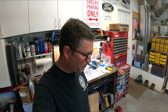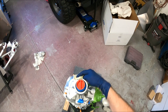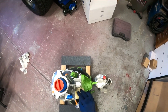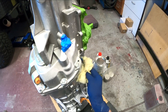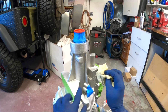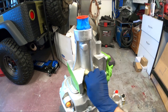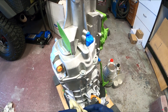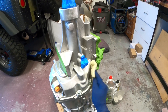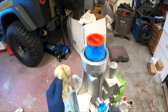It's in the upper 50s right now. We're going to try to spray the etch primer on first, then white, and then we'll clear it — so this transmission is going to look awesome. I've got my tack rag here and I'm going to try to get any of the extra debris, since I used paper towels to wipe it all down with acetone. You can see it's picking up some of the paper towel fibers. You don't want to drag one of these tack cloths across something because it's just a sticky mess — just blot it and hit it pretty quick.